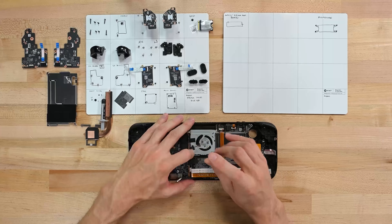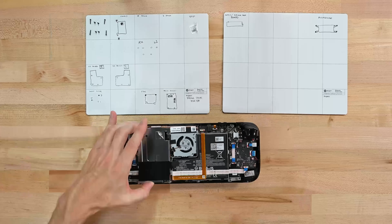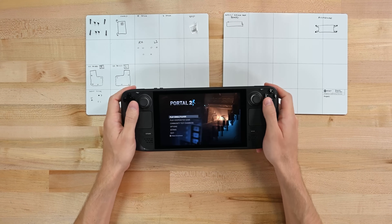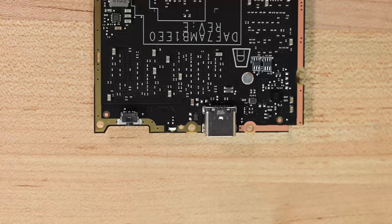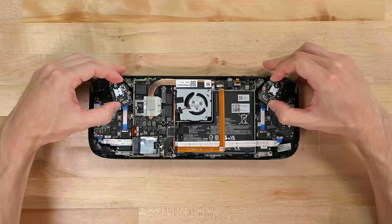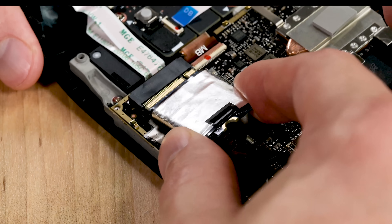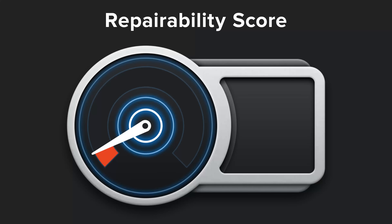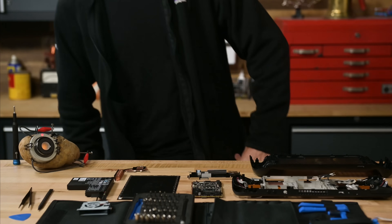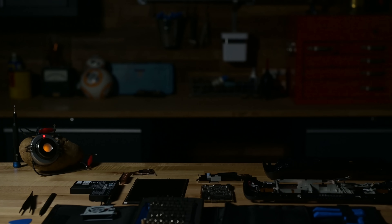So what does all this mean if you end up needing to repair your Steam Deck? Even though we went farther in our teardown than some reviewers, we're happy to report ours went back together in perfect working order — and that's usually a good sign for repairability. We do have some significant gripes: the battery is a missed opportunity, and we would have preferred a more modular charge port. But we also found a lot to like: the opening procedure is simple and straightforward, there's above-average modularity for most components, and you only need one Phillips screwdriver for all your repairs. The storage solution here outclasses a lot of current laptops. Overall, the Steam Deck nets a 7 out of 10 on our repairability scale. If you're hungry for even more info while you wait for your Steam Deck to ship, be sure to check out the links in the description for a deep dive into the chips, high-resolution X-rays, our thumbstick drift explainer, and more.